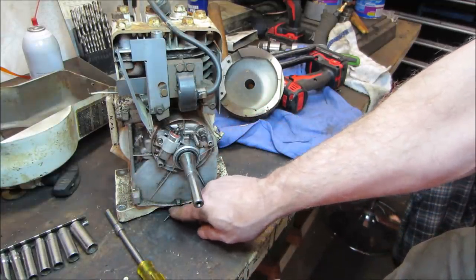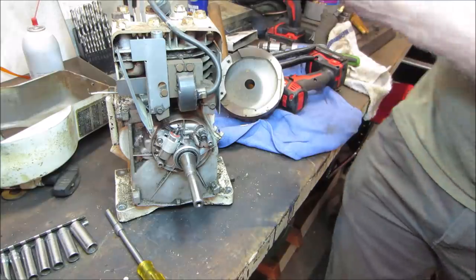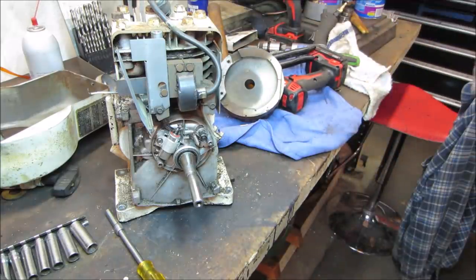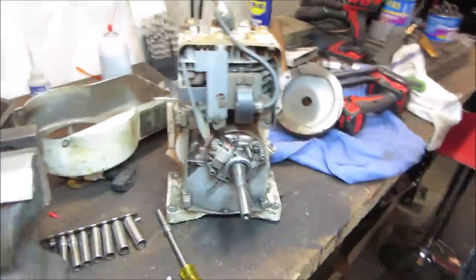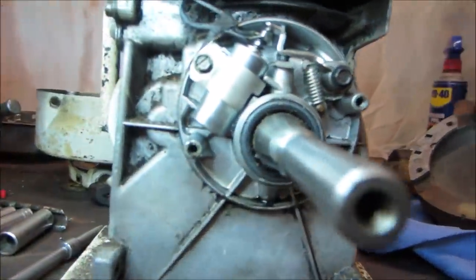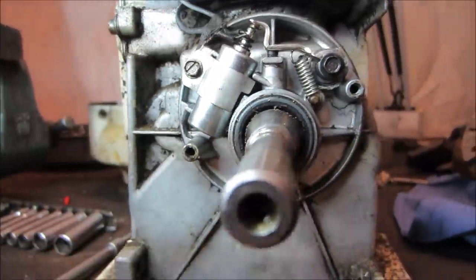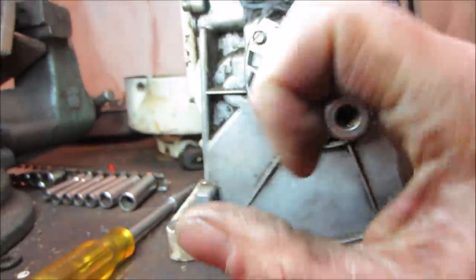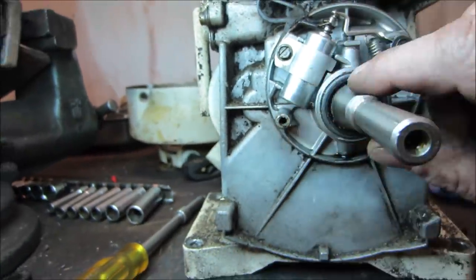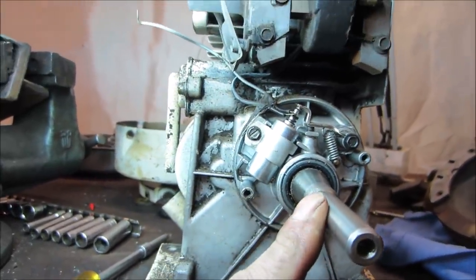Let's go take a peek at them. Generally the tips of them just get kind of corroded. They look really clean though. No matter what, we got enough parts to fix it. So the other engine already has spark. Let's get you close in. Let's go see. I see some kind of like hair going across them. Let's go. Make sure they're closing. They close. They do look super clean though. Could be a bad coil too.